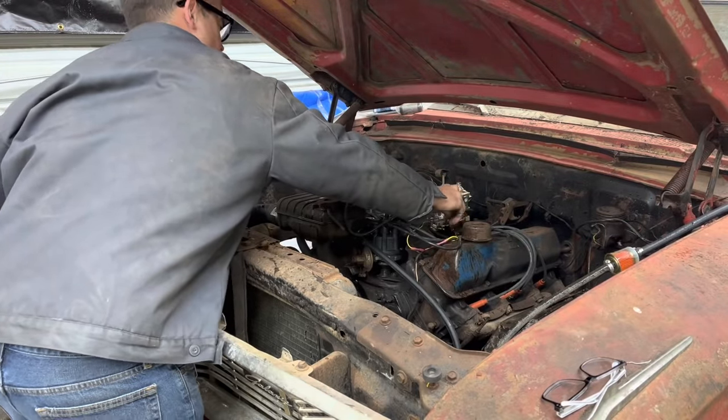Gotta love these little simple 2-bolt master cylinders. So, these are not very safe to use. Basically, you have one line, one reservoir. If anything goes wrong with your brakes, you lose all your brakes. The only reason I'm using a new one like this is because you'll see in later videos we'll do this car. This is historically accurate to what I'm planning on doing with the car. So that's why I'm using it. Rocky's found the old Vienna can over here. Mmm. Yeah, is that good?